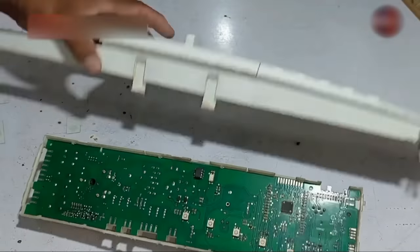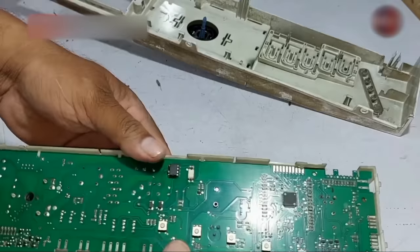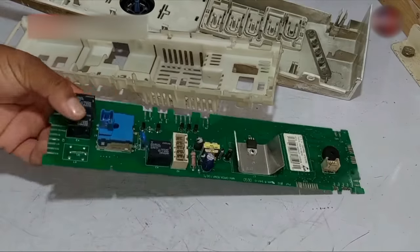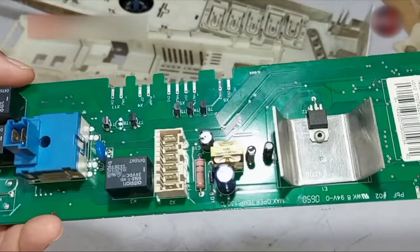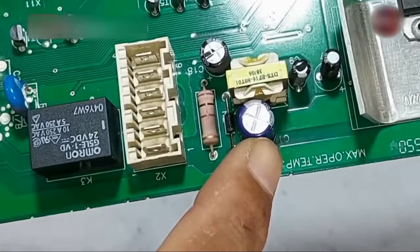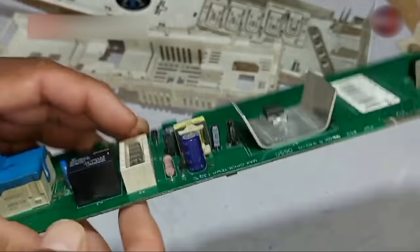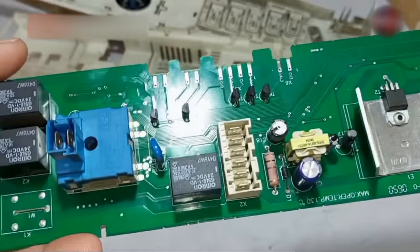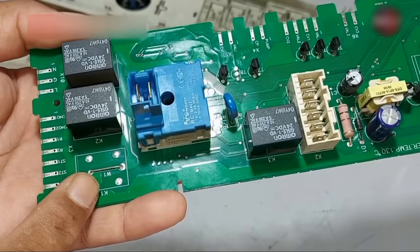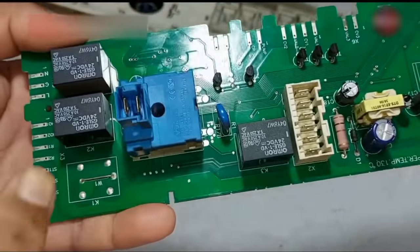I have opened the complete cover and this is the PCB board. Let me explain how the motor is controlled through this PCB. The PCB has an SMPS which is used to power the PCB, a chopper, and a switching IC. This PCB also has bigger components — 3 relays are installed in it (the 4th relay position uses a jumper wire instead). I will explain this as well.